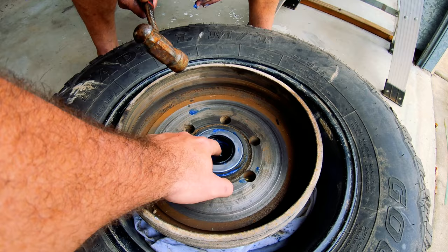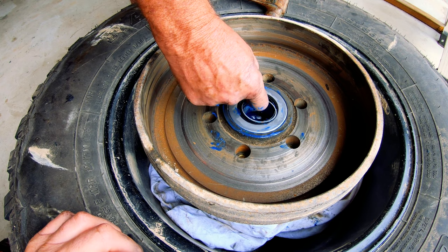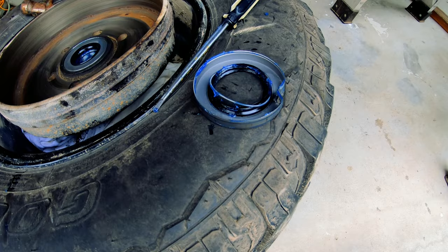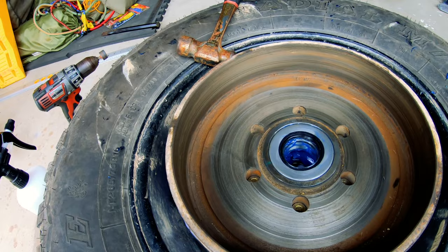What's happened here - oh no. It goes on the outside - no, it goes on the inside of it. It's fallen out. All right, brand new seal. We've had to punch it out because this little spring that keeps tension on it has fallen out. Glen reckons that's the first time it's happened to him in over a thousand wheel bearings. Anyway, luckily bought spares.